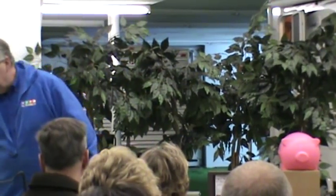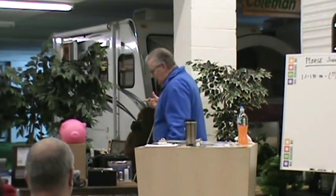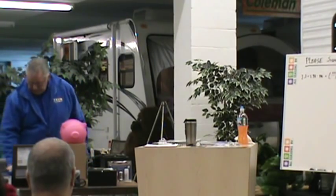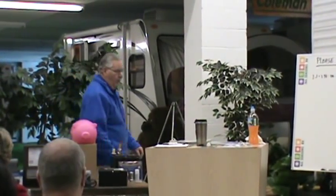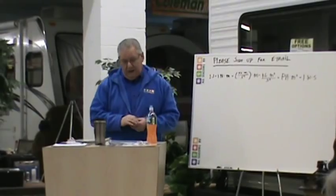It's good to have a little device like that. They're not expensive. There's one pictured here, this one with this digital monitor. This one's a little bit more elaborate. This one runs about $83. This yellow one's about $19.95. Good enough. Maybe $29 for this one. You should have something that tells you that you're getting the right amount of 110 volts when you plug into the campground.